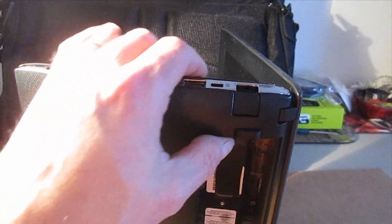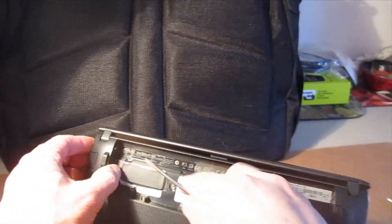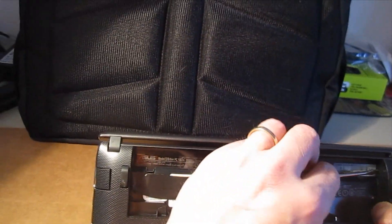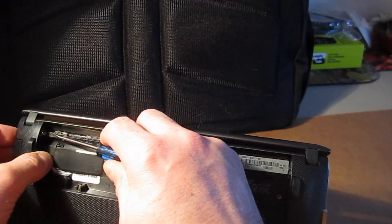You can sometimes get these edges with the credit card if they give you a difficult time. There are little tabs here — if you just take a little screwdriver and push those in, the sides will release. There are tabs all along the back here too under the battery. Usually once you get the front and the sides, the back will pull out.